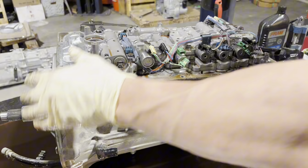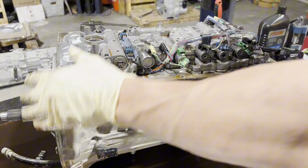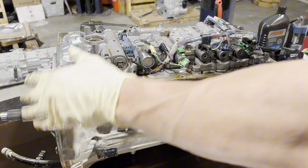We have two temperature sources. We just did another video - there's a whole thing on these valve bodies and people on eBay selling the incorrect valve bodies. The long and short of it is there are two kinds of valve bodies - they don't really interchange. You have a one-sensor style and a two-sensor style, so these are both temperature sensors and they both have holes that they plug into. Your orange one always goes on the side of the linkage.